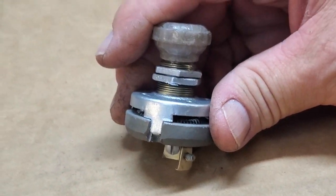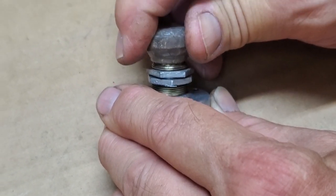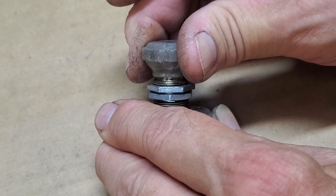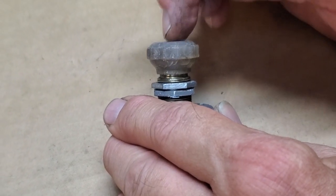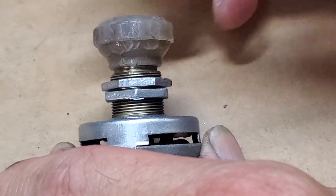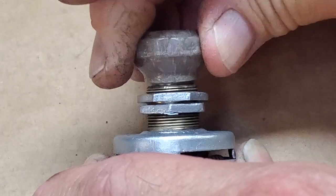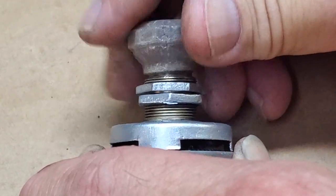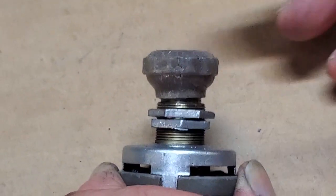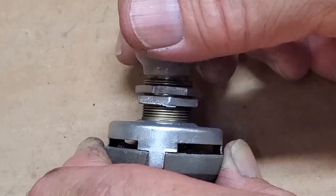The switch is a resistance switch. It's currently in the off position. If I turn it one position, we go into the on, and we have a second position and a third position. You can kind of hear it click: one, two, three. At the outmost position, it's using a lot of resistance because inside are resistance wires, doing the control of the fan for the heater motor using resistance. The problem is that eventually a resistance switch would wear out, so I recommend using it by clicking it on just once because you're not using the resistors — you're sending the power over to the fan. All positions work, and it lights up the moment you turn it on.